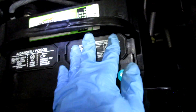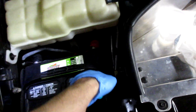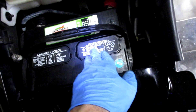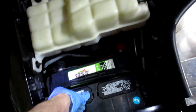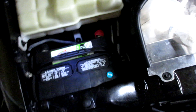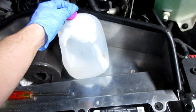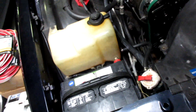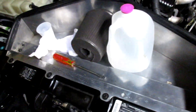There really were only two that were kind of low — not that terribly low — but if it makes this battery last any longer, I'll check its state of charge and see if it changed anything. Yeah, that's in the same way — it only will go in one way anyway. Just make sure it's seated down all the way. So that's how you do it — easy as that. I think some people who recycle batteries just recycle the electrolyte — they put new sulfuric acid and distilled water solution in there. Batteries cost a lot.